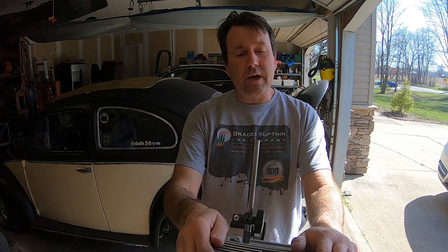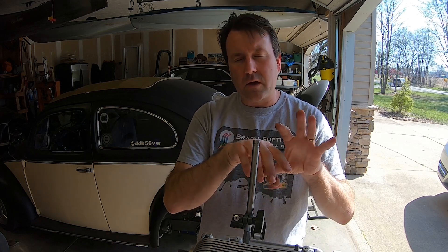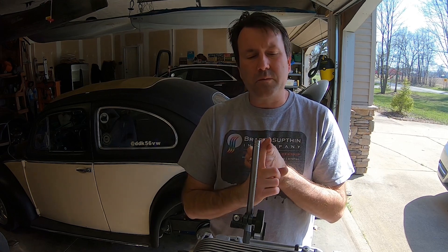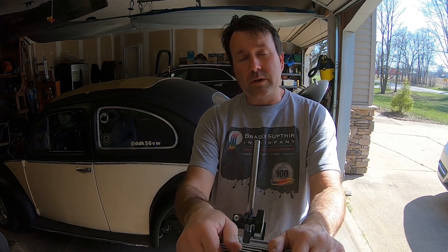I pretty much ordered these things and I'm going to run them right out of the box. I did make a few checks. The other check — I think I've already got a video on it; I'll link it below or at the end of this video — is where I checked the CCs of the combustion chambers. I used windshield washer solution; it's a little thinner. I also checked to see if the valves are leaking and didn't have anything go through the valves at all — so that's a bonus. It means CB Performance did a really good valve job. Stay tuned — I believe I can put the long block together. After that will be the turnkey application. I'm waiting on the intake manifold, and I still got to fit the manifolds and do a little bit of work on the turbo. Until next time — keep shifting those gears, keep cruising, and always enjoy the ride.